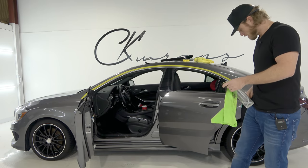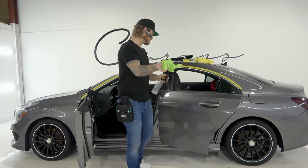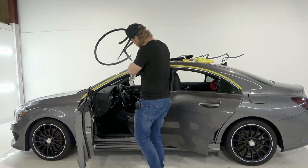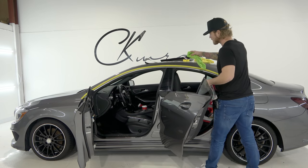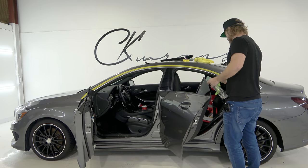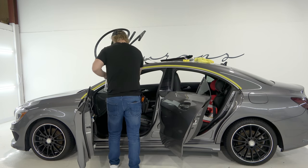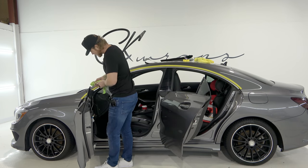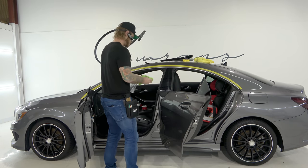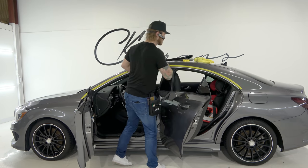Once we wipe the face, we're going to take our rag, put it around our squeegee — I'm using a gold or hard squeegee — mist it slightly, and come across the top edge. The reason this difficulty varies from car to car depends on how large these gaps are. The gap on the Mercedes is reasonable and I feel like they designed it for chrome trim deletes because it works very well — there's a lot of space in there. We'll get in on the bottom side as well. You can get away with using the squeegee but it might not be as accurate, and I'll explain that in a second.